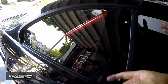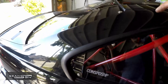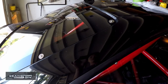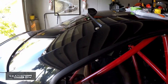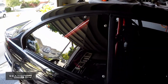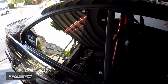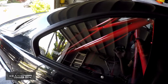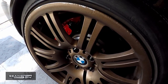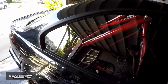Overall I saved five pounds on this side and five pounds on the other side, so 10 pounds. I also saved eight pounds on the rear window, so that's 18 pounds. I went with a lighter weight battery too, which is another 11 pounds. Over the past couple weeks I saved about 29 pounds. My car now weighs about 2875 lbs with a half tank of gas and no driver. Can't wait to try it out on the track — the car's going to be lighter, plus I get to try out my new upgraded rear brembo brakes. Please like and subscribe. Thanks for watching.